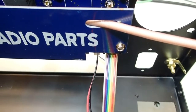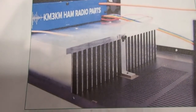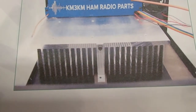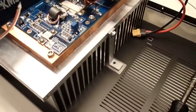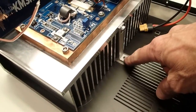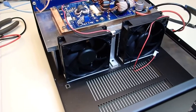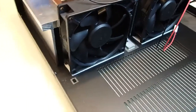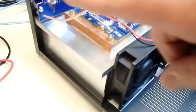The next thing is to install the power unit assembly, held in place with three cap screws — one goes in from the bottom and two go in from the back. Here are the fans installed; you can see the hub of the fans clearly from the back, and arrows on the side indicate airflow direction. You want the air coming in and going toward the back of the case, blowing through the heat sinks.